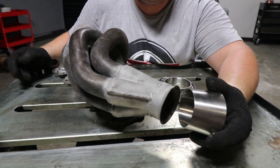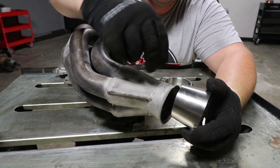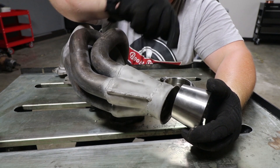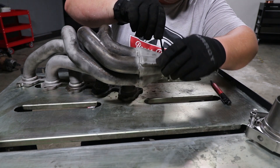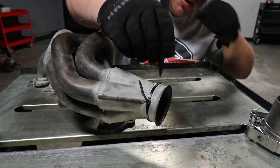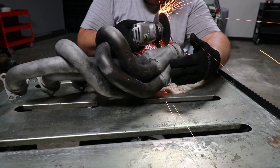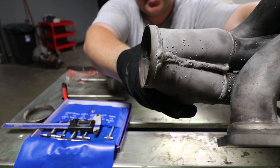However, the header's not two and a half — it's actually larger than that. So I'm going to have to start by chopping this off, getting rid of the ball and socket portion and coming back to a nice level and flat portion of this header. Then measure it, measure the reducer, and cut the reducer as well. To try to make as straight a cut as possible — and I haven't done this before — I'm going to throw a zip tie on here and then mark my cut line off of the zip tie. I've seen people use O-rings, I've seen people do a number of things, but this has got to be better than using my naked eye. Once you cut the zip tie off, it looks pretty straight. After a quick trip to the belt sander, it is nice and true and straight.